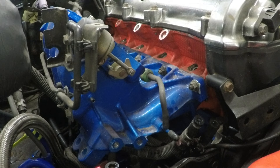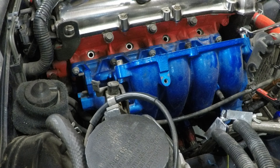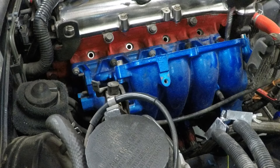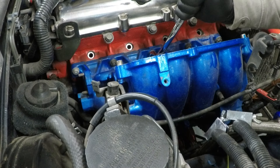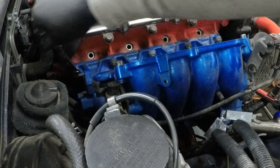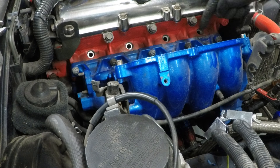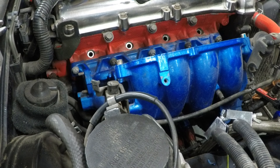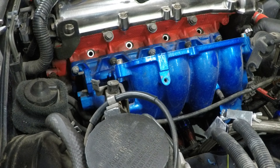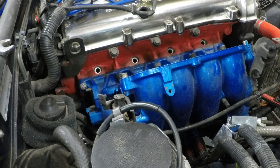To remove the bottom of the intake it is five bolts across the top — easiest with a swan neck. There's one on the end directly underneath this port, easiest with a C-spanner. The other three are directly underneath the intake ports.